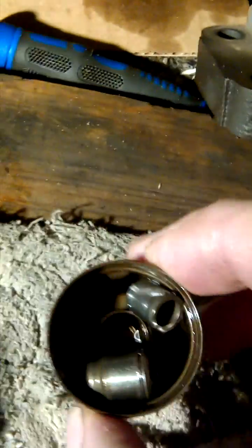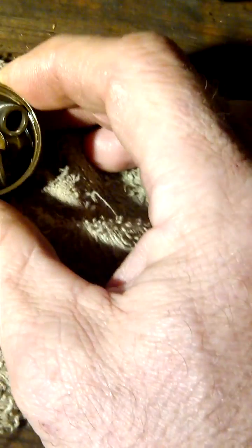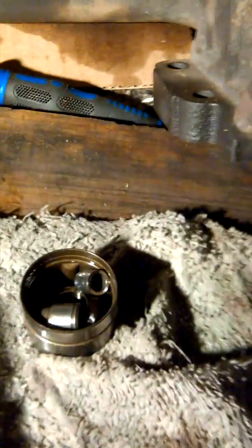Just a little follow-up: what I'm doing with these lifters is cleaning them off — they got a little gunked up in there, so they've been making a bunch of noise. I'm going to take them all and put them in a little bucket with a combination of varsol and brake cleaner to get them cleaned up.